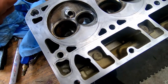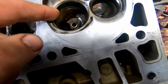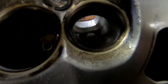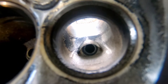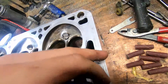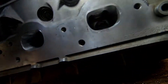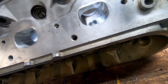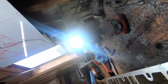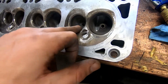All right, I think I'm pretty much done with this cylinder head as far as the burr bit goes. I went ahead and threw it in the parts washer and cleaned it up a little bit just so I could see what I was doing better. I should have done that beforehand because carbon deposits everywhere tend to clog up the burr and the sanding rolls more so even than the aluminum. Here's the exhaust — I'll just clean that guide up a little bit and raise the floor. Intake side: just knock that bump down, give it a little taper. I'm going to take the sanding rolls and smooth these chambers out so stuff doesn't stick to them. Just took the sanding roll to it and smoothed everything out, knocked that guide down just a little bit. I'm going to do the same thing to these chambers — take the sanding roll to them. I'll put my valves back in here before I do it so I don't nick any valve seats.